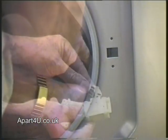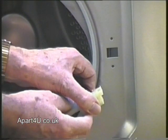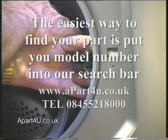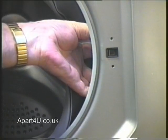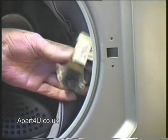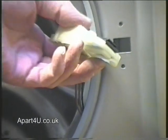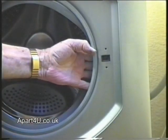What we're going to do now is plug the wiring harness into the door lock. Most of the plugs can only fit one way. If you have terminal connections on the door lock, you will need to consult your wiring diagram or your photograph to make sure you get the wires on correctly, and also check any additional notes with the door lock. This door lock hooks into place — you can see the lip on the edge of the door lock which hooks into the panel. Some are flush fit, and others have a plastic piece which will go onto the door lock through the panel.